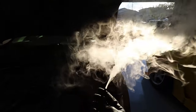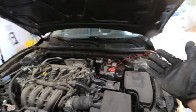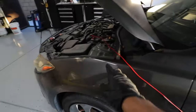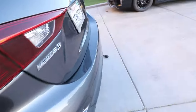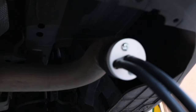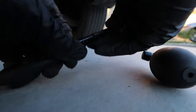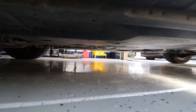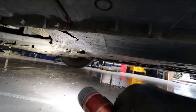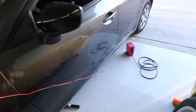Testing the back of the evap system is kind of pointless since it's not leaking, so we'll go ahead and go to the exhaust side. It was actually able to reach all the way around — we've got the exhaust adapter pumped up and the hose right in there. On a compact car you're going to have enough room. If you were looking for an exhaust leak you'd have the car jacked up and go around inspecting. This would be very helpful if you're getting a lean mixture or O2 fault because of an exhaust leak before one of the oxygen sensors.